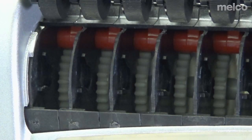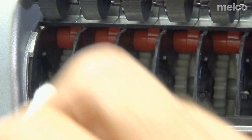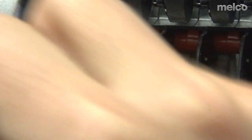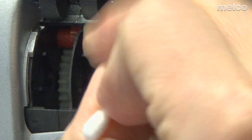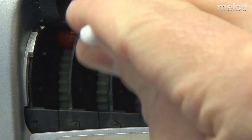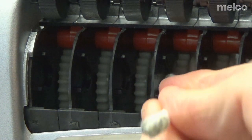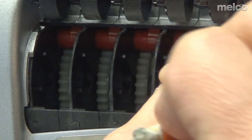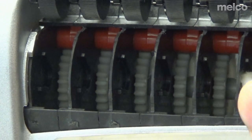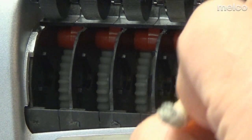Now we've got a zoomed-in view of where those rollers are, and we need to clean out where the hub on those rollers rests. We'll clean this area out on both sides. We get in right where that hub rests and clean that out. Make sure you're not leaving little bits behind — that's why we suggest a lint-free cloth. You can wrap that around your applicator stick, and that really helps.